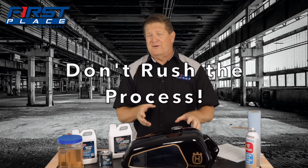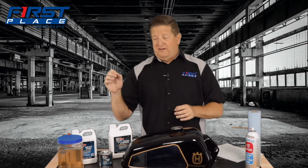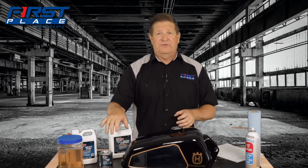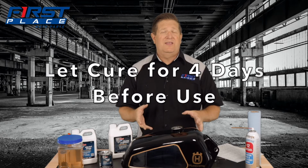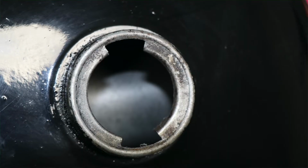Overall, I have probably close to 4.5 to 5 hours in not only preparing this tank, but then cleaning it, degreasing it, and then adding the actual sealer. Once you're done, the tank will have to set for up to 4 days before it's fully cured. Like I said, you want to get all the excess sealer out. Too much is not a good thing in this case. All you need is a good coat.